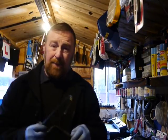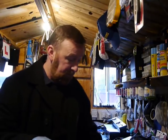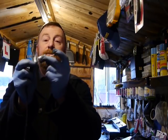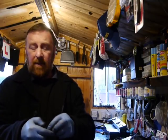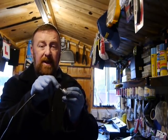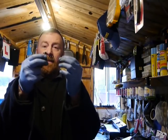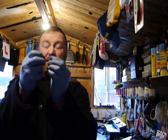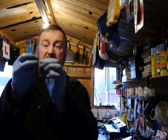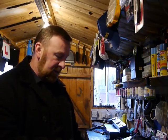When taking the cable off, as I said, take pictures. Take the actual accelerator throttle bit off first, and you get much more cable here. This allows you then to be able to get the needle out of this little bit. This just hooks in — it literally just hooks through. This can be a bugger to get out. On the Speedfight, it's got this little shaft bit that it can travel down; these ones it hasn't. You have to push this in to be able to get that out, twist it round, and it comes out. Don't lose the needle. Don't lose any pieces — real bugger if you do. This is the spring that normally is connected onto here. This is what keeps it taut. Getting this out, you have to, with your fingers, screw up the spring as much as you possibly can to be able to get this little sleeve out. And that's what this sits in and then pokes through this part here.